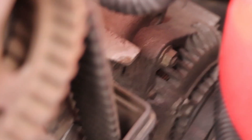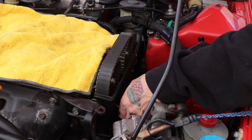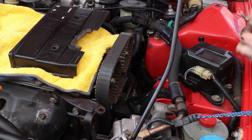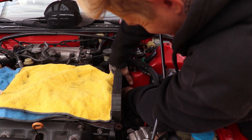Also don't forget your alternator belt. Loosen the alternator with the 12mm bolt up top, and you may want to loosen the bottom bolt as well — you'll have to access that from underneath. Then pull it towards the front of the engine bay and slide the belt right off. Go ahead and take your top timing cover off; in this case there's only one 10mm bolt — normally there are two, but this vehicle was missing one.